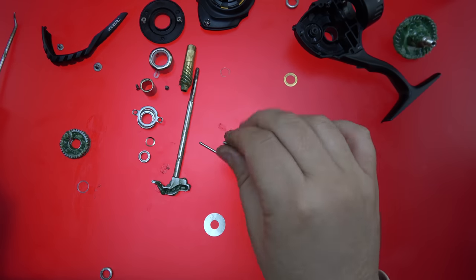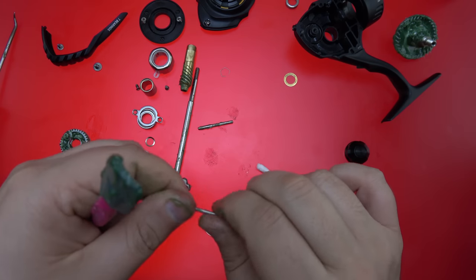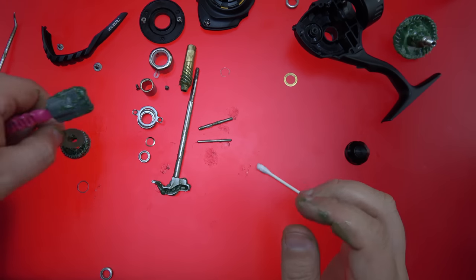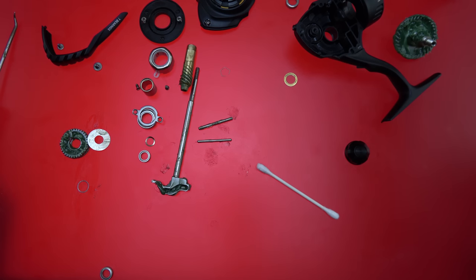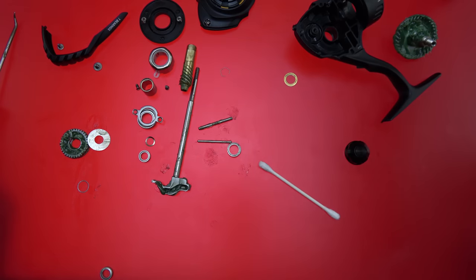Alrighty. Now these, you can go light. Was it completely loaded up? And this washer here, we're also going to apply a nice liberal coating of grease. It's at this point now, we're not going to do anything else with the frame, but we're now going to service all the bearings. And now I'm not going to pack every single bearing on camera. I'm just going to do one, and that's going to apply to pretty much every other one just to save time, because bearings can take a little bit of time if you don't have a bearing packer. So we're going to do it the old school way and pop the shields and then just inject the grease into the bearing, and stay tuned for that.